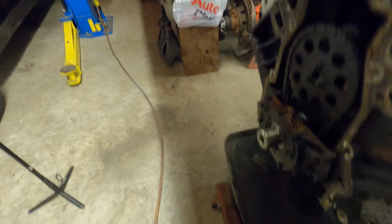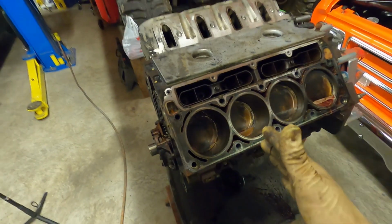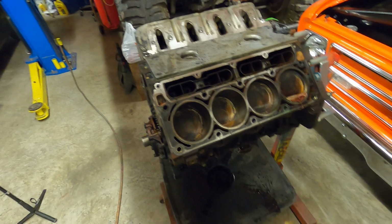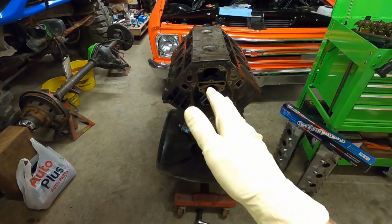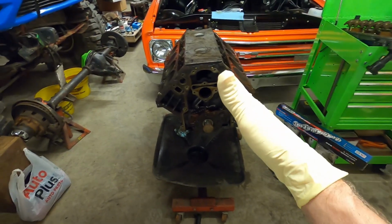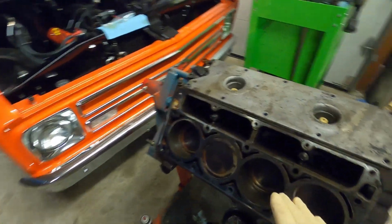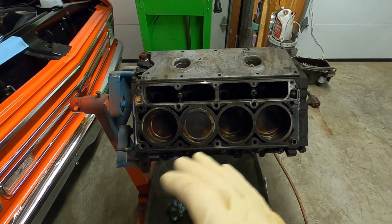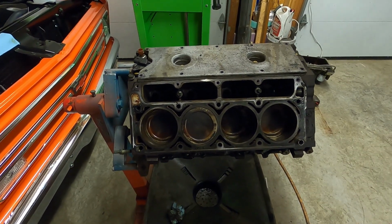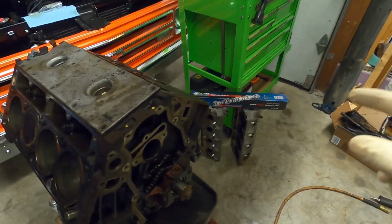They're fairly light, so we'll just go ahead and set this down. And we'll look in here. You always get some coolant and stuff running down the cylinders when you pull the cylinder head, but we lost GoPro battery again there. So anyway, we have both heads off. Cylinders look really good. I've never really seen one of these 6 liters, even with higher miles, that the cylinders are just trashed unless they were really abused or blew up. But anyway, we did get both heads off.